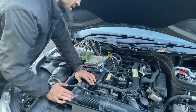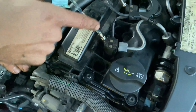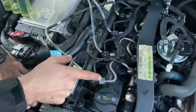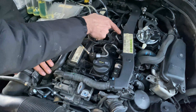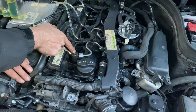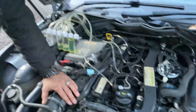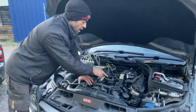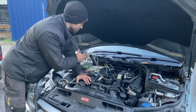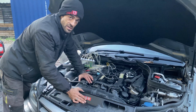So to do that, we've got a size 17 fuel line and an electrical clip — we have to take the electrical side out. These work on solenoids because it's a common rail. We'll unclip the electrical side, undo the fuel rail on both the injector side and the common rail side so the fuel line is loose — we don't want to be bending it. There's one bolt holding each injector down; we'll jiggle in there, lift it up, pull it out, swap it over and see what we get as a result. I'll do a video on how to replace these once you've got new ones. For now we're just swapping it around — this is just for the purposes of a return line test.